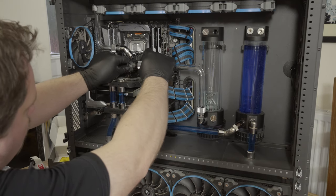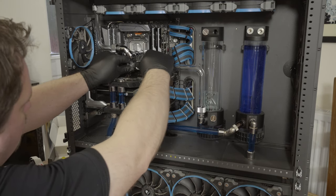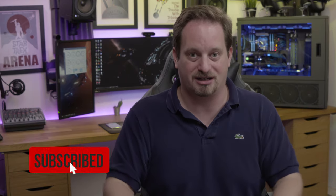So I think really the key bit for this is the pre-measuring out with the PETG. You're effectively doing your tubing twice, because you have to do it in PETG to get yourself millimeter accurate in terms of your sizing, but it's well worth it, where you may do 3, 4, 5, 6 attempts at a bend with PETG, which is relatively inexpensive. It's not dirt cheap, it still costs money, but it's relatively inexpensive. You're not wasting pieces of glass that are £10 a piece. Definitely the way to go.